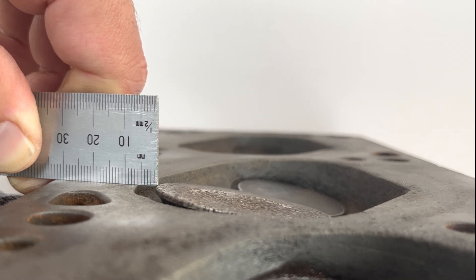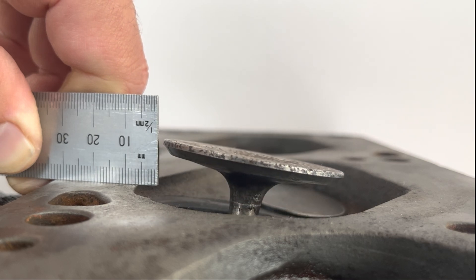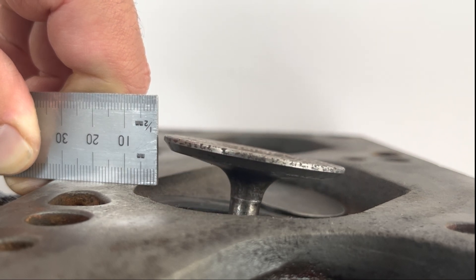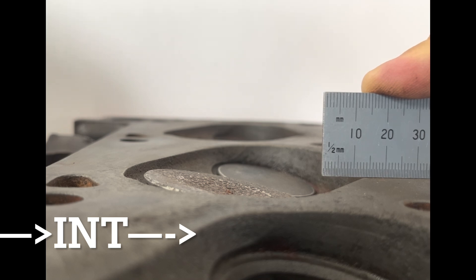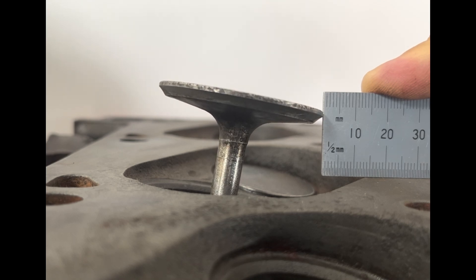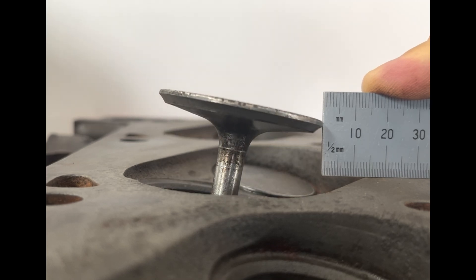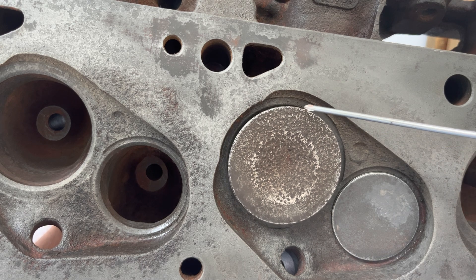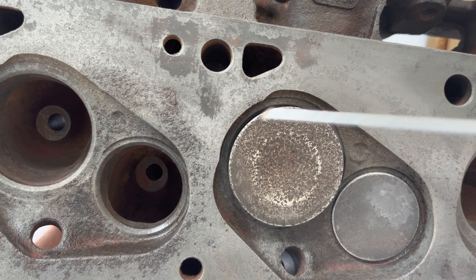With the straight edge on the deck - this is an over-exaggerated explanation - look at that, and as we lift the valve, look how it moves away and then cants back. On the other end - the back wall of the intake port - this is an over-exaggerated inch of lift, but you can see it touching the straight edge on the surface of the deck, and now look at it going back to its seat. See that angle? That's canted.